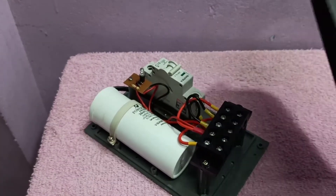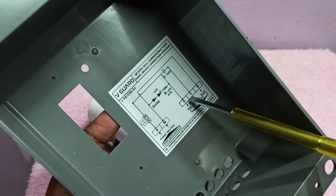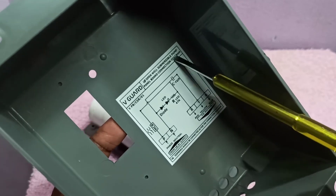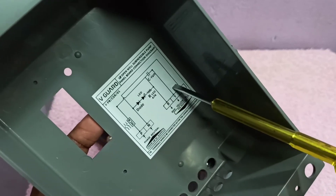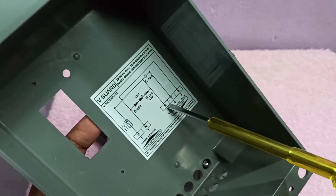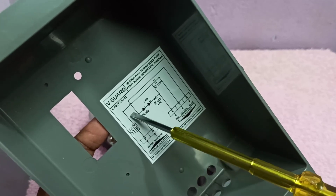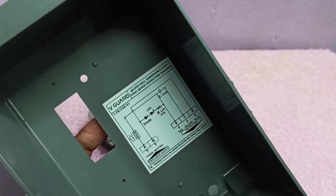I will show one more diagram printed on the cover. You can see the red, yellow, and blue cables going to the motor. Between red and yellow a capacitor is connected. The blue wire goes directly to the neutral of the main power supply, and the phase connects to the red cable going to the motor. There is also an optional LED light, and if you want a switch you can connect it in the phase wire. I hope you enjoyed this video — please subscribe, like, and share.